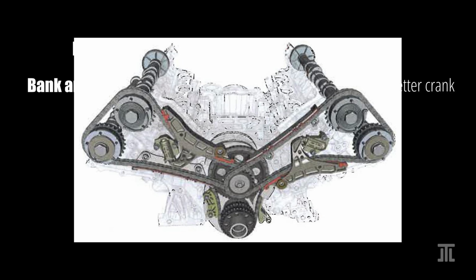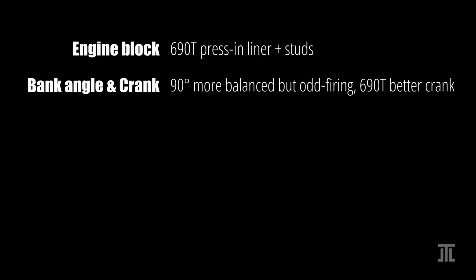Because the overlap of the power strokes is small in the 150 degree interval, the movement of the crankshaft is not balanced. Neither is as ideal as an inline 6, but neither uses balanced shaft. This is because balanced shafts would add to the inertia of the rotating assembly. Also worth noting is that Alfa Romeo advertises nitride surface treatment on the crankshaft, which is another premium feature.